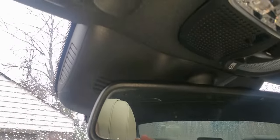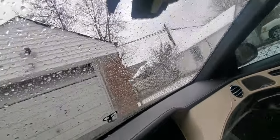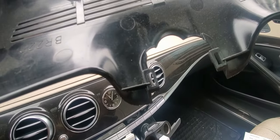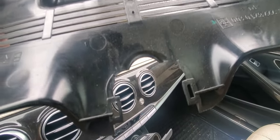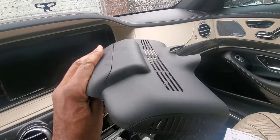I'm going to go ahead and show you how to get to that camera. This piece right here houses the camera — you don't need any tools, you basically just pry it off until it comes. We'll remove this compartment. Now I've got the main cover off and you can see access to the camera. The center piece has two slots where you want to pry it off very gently. The part number for this main cover piece is 8222-821-03-00 — that's for the plastic piece that covers your multifunction camera.